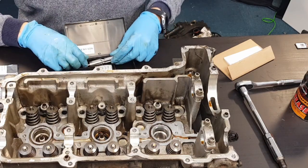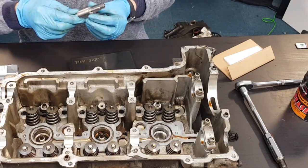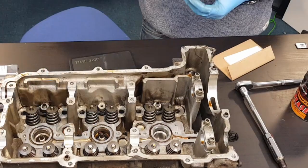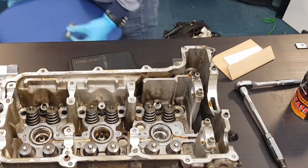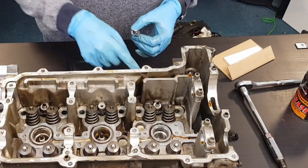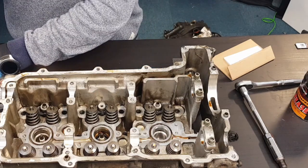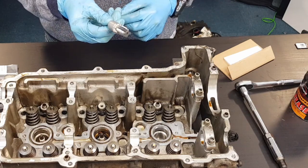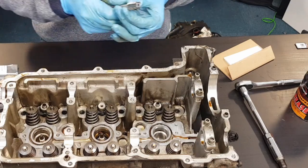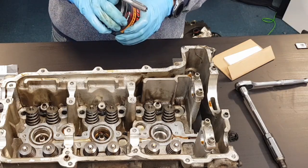That's the theory — this is the first time I've used this kit. I'm using a scrap head I've got; it has a crack on it and cylinder intermix issues, so it's probably not economical to repair — I'm just using it for practicing. I've also got a piece of paper underneath the head. The theory is that this can all be done with the head on the engine, and by putting grease onto the cutters all of the swarf can be captured. The paper will let me see afterwards how much swarf there is.